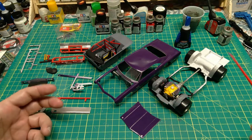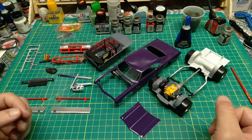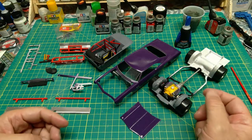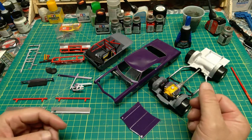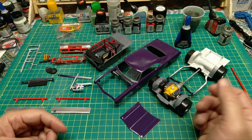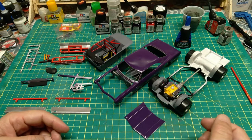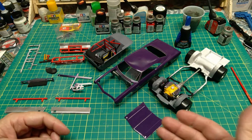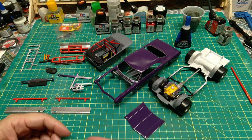And, you know, this goes in the pros and cons category of how you do your work. I've said several times, and with this, I mentioned that I did my spray painting in my garage. Because it was a nice warm day, I had the garage door open. It was the height of pollen season. Apparently when I did the spray paint for the body color, where I had the hood, a whole bunch of pollen had settled into that nice wet paint. So instead of a painted surface, I had what looked like stucco on the hood. So that had to be sanded down and resprayed.